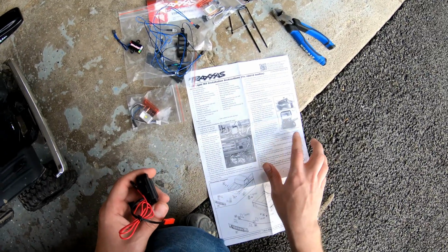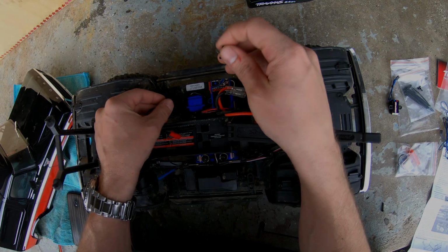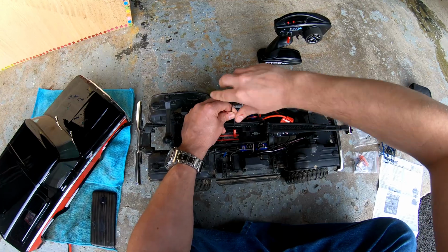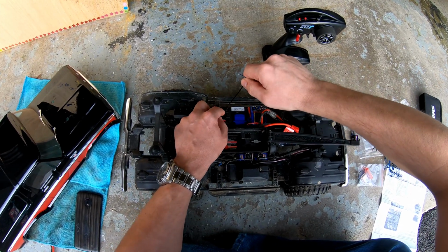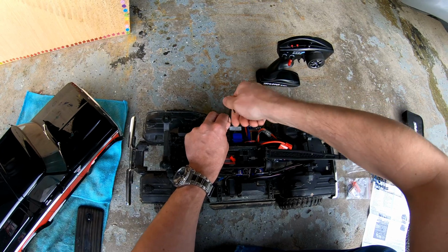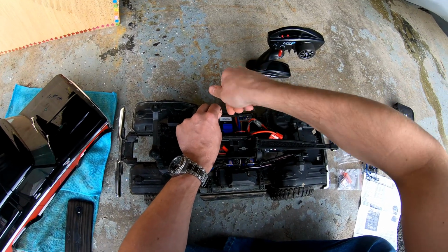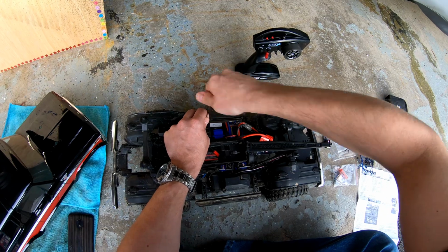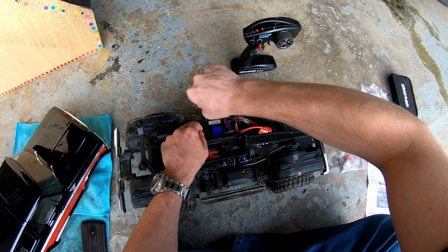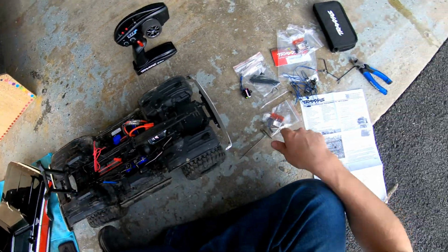So it looks like it's going to have us route this wiring underneath the battery tray. So, and this guy just sits right in there. And get the threads started here. Alright, there's one. And I think we just got to loosen the two screws holding down the battery tray on the rear side near the motor, just to sneak the wiring underneath that. Yep, almost there. As always, they give you way more threads than you need with these things. So I do think you are just going into plastic here, so do not over tighten. All right, that guy is secure.